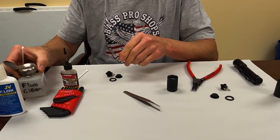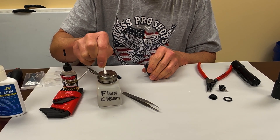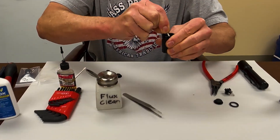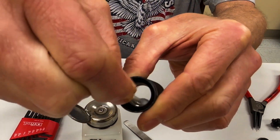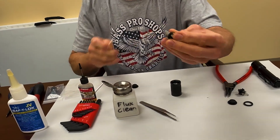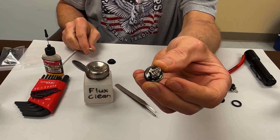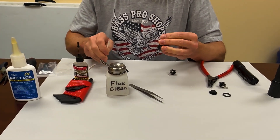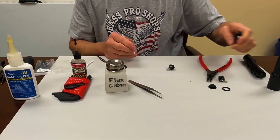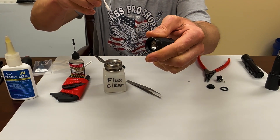Then what I'm going to do is use my flux cleaner — acetone, rubbing alcohol, any solvent like that will work well. Get a little bit on here and I want to clean this little landing down in here, because that landing actually mates up to the mating surface around the edge of the light. If there's any gunk, you can see on this one it's got some gunk built up around it. I'll still just go over it real quick, cleaning that groove that the O-ring sits in.